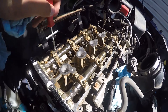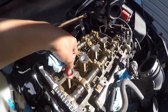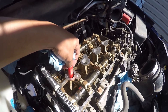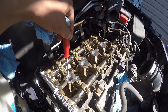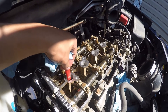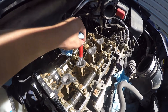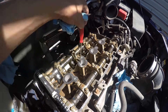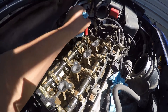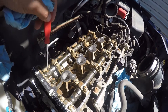I've got my chain in and everything. Small note here talking about TDC, or top dead center. I've got my screwdriver and all the spark plugs out — you can see this one goes in there and the handle still hangs out, but if you drop it in the center two cylinders, those pistons drop right down. So just remember that when you're looking at it — check for top dead center.